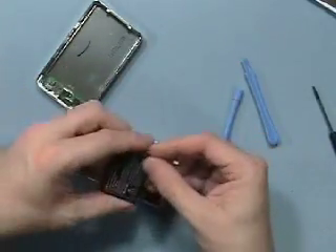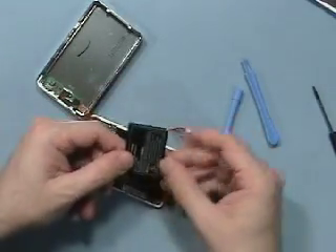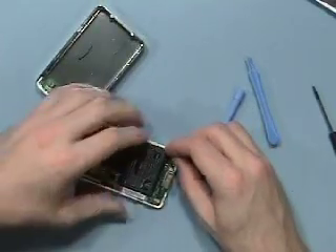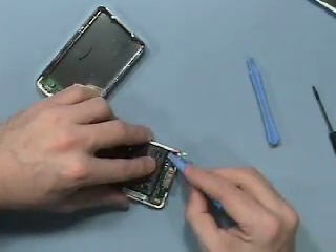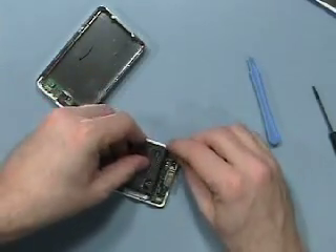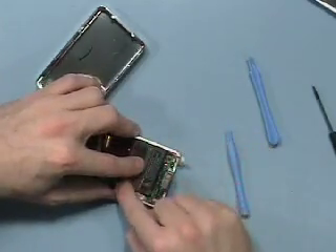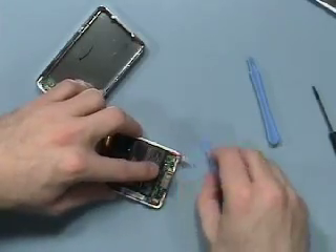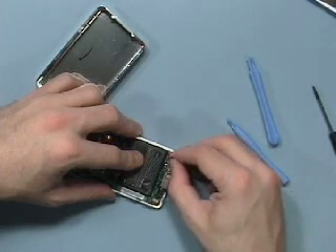Take the replacement battery — because this is a very tight fit, make sure the wires are pressed as flat across the top as possible. Set the battery into the bay and push towards the wall of the battery, then set it down in place. Make very sure that the green circuit board is not pressed down with any pressure. If it is, take the battery back out and repeat the process, pushing towards the dock connector. You do not want any pressure on the green board on either side, as it will bow and could cause damage to the logic board.